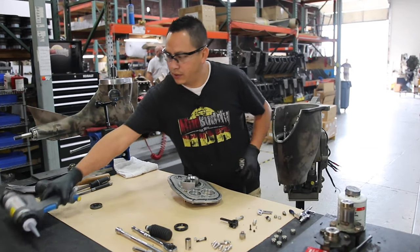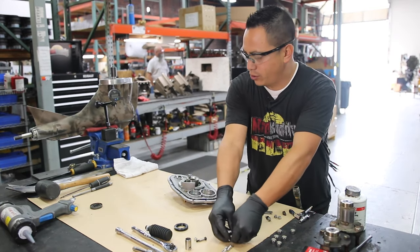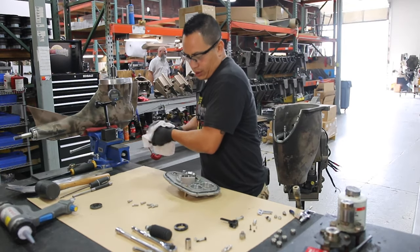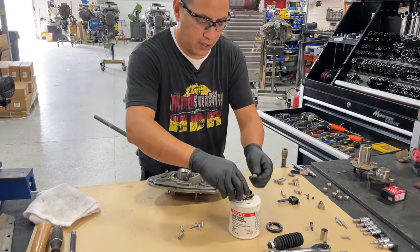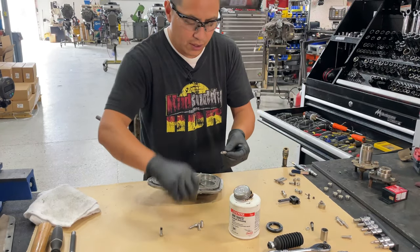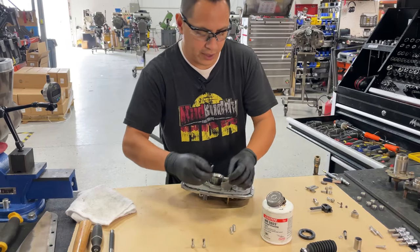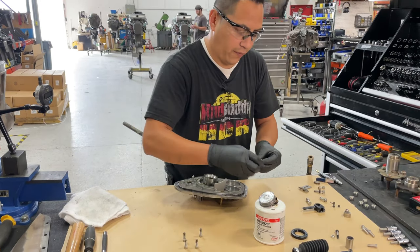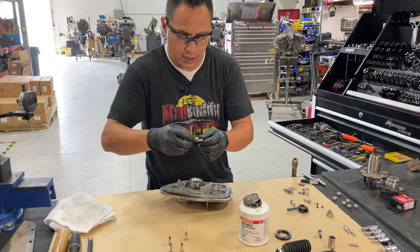All right. Here we go. We have 8 screws right here. And the screws, actually, I also use a little bit of aviation sealant, Permatex. There's so many names for this thing. I just call it Permatex. I think actually that's the brand, but it's called aviation sealant. And just a tiny bit, just enough so we don't make a mess, but it gets in the threads.